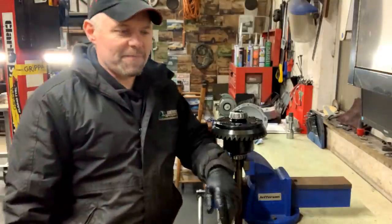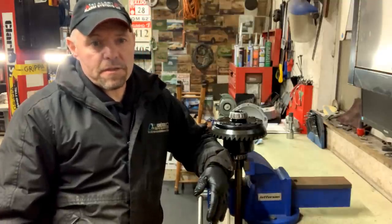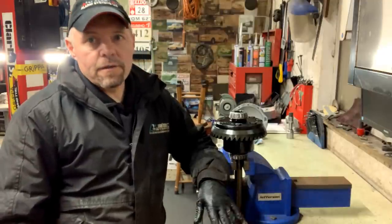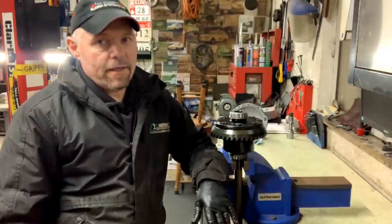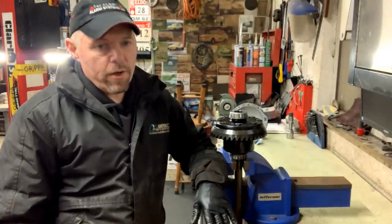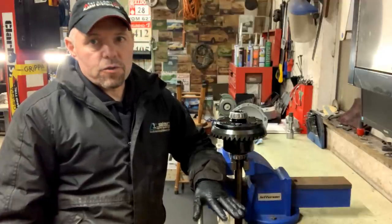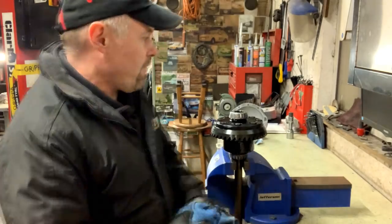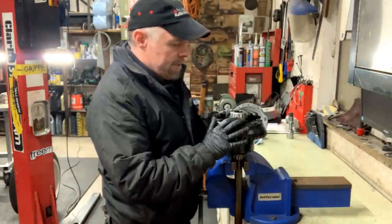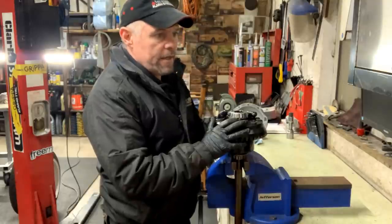The question everybody asks now is: what preload should we be getting? That's a million dollar question. There is no set figure in my opinion - everybody wants it a bit different. I usually aim for somewhere around 75 Newton meters on this bench. Somewhere around there, and then two or three rallies later check it again. If it's gone down, bring it back up again - keep it near the 75. It differentiates with the heat of the oil, the heat of the car, expansion, everything like that. But I just use a basic figure of 75 Newton meters on my bench - that's what I default to all the time. You have to have some kind of a figure to work towards. So now I'm going to take the top plate off, get a look inside, lay the depth plates out, measure what's in there, and then we'll start mixing and matching with a new plate set to see if we can get somewhere near 75 Newton meters.